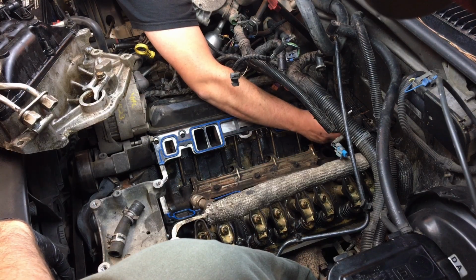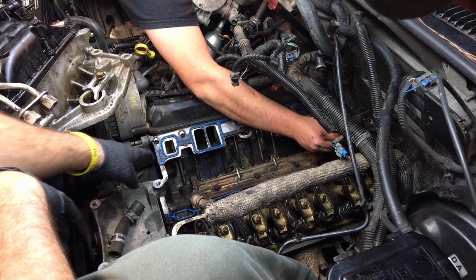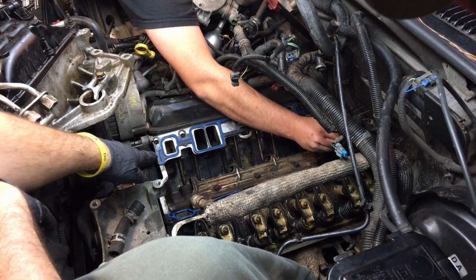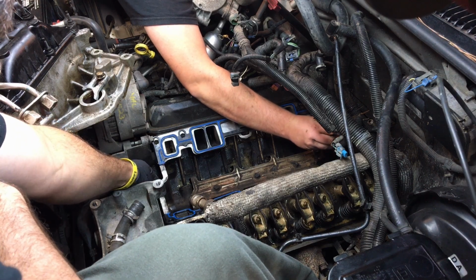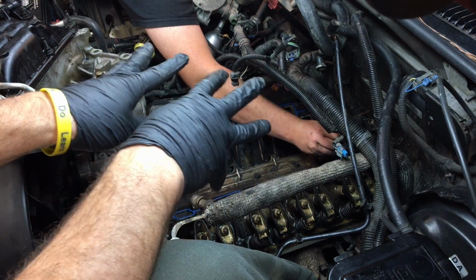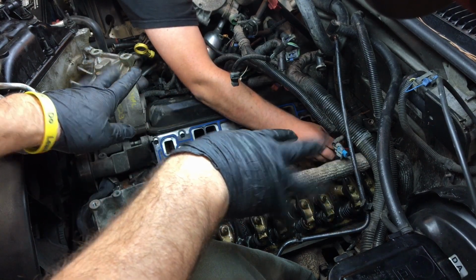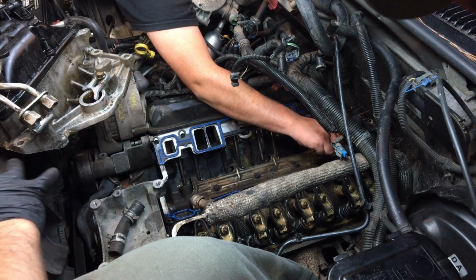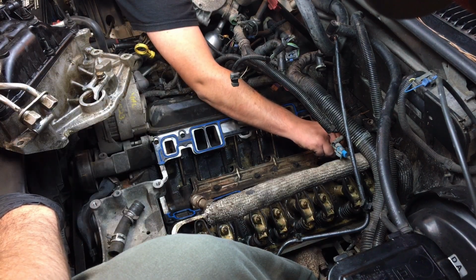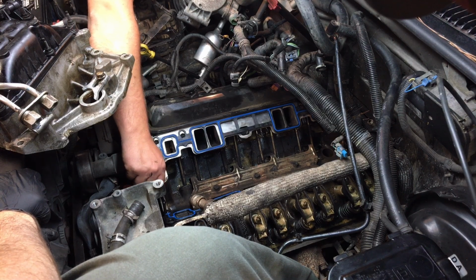I like it. Once you put these intake gaskets on, you got to put a bead of silicone around what we call the China wall down there. I think you can see it. That's part of it right there. Look at the little China wall. When the intake sets down on it, the old room temperature vulcanization cream just eases out, ends, and seals it up. That's way too much silicone. Perfect.